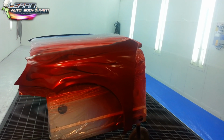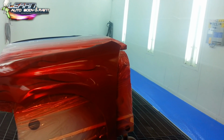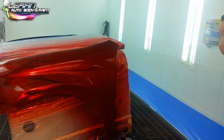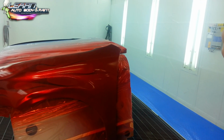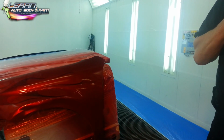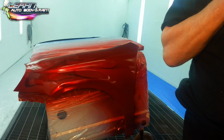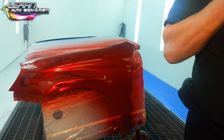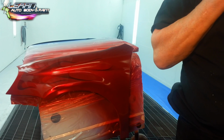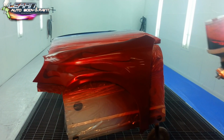To the touch? Yeah, base coat. This is SG100. Oh, right, it's base coat. But if I was using a catalyzed clear, it would be not stringing up when I touched it. In other words, sticky but not stringing. Okay. Now, if you're using the UK KO1, like I said, you can go have coffee, have a sandwich, come back in 30 minutes and pick it up. You couldn't do that with the old system.